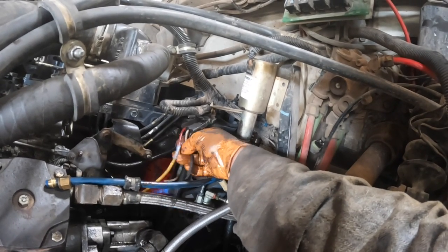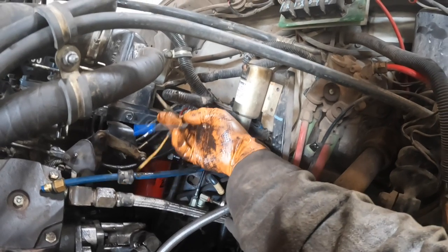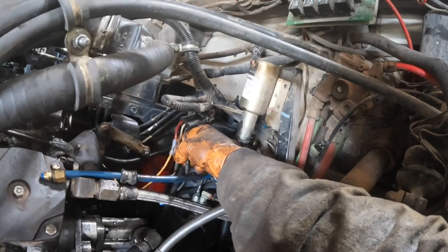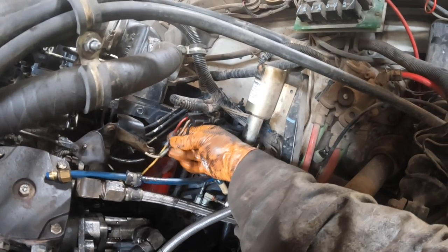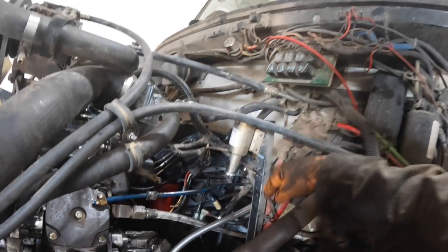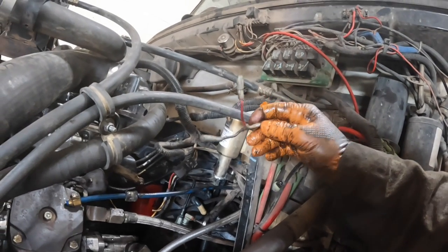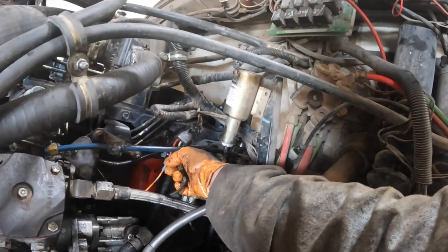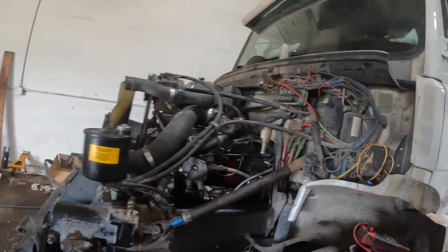Okay, so I'm actually on the pull in wire, which is key on. This is the hold in when you're going on the start position. Well, see, I might have that all screwed up. I don't remember tonight, but this might be the pull in. This is the hold in when it's actually in run. This is the ground. My crane and this whole board up here is powered from these wires they got here, so I need to tie in to that because that's where they used to be. That's how they had it tied in there. And I'm just pretty stoked, man, that it runs.